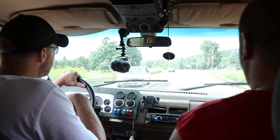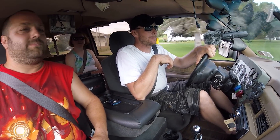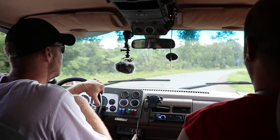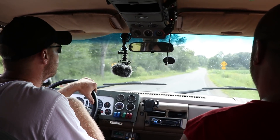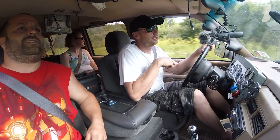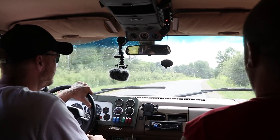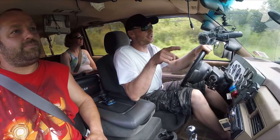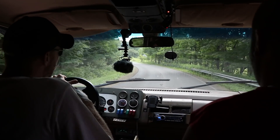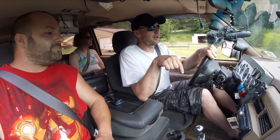How long have you had it on the road? About three years. You rebuilt the whole engine too — rings, bearings, head studs, had the head shaved down just a touch. I do all my heads whenever I have them off. It's an HX40, governor springs at 4,000 RPM, shaved the fuel plate to zero, and made my own AFC housing.